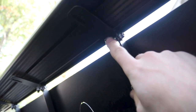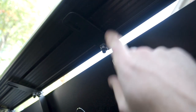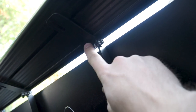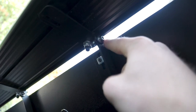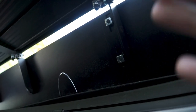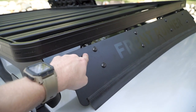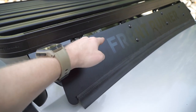This corner cap is held on by one bolt, so I just popped that right off. The underside of your mounts looks like this — a 13 millimeter bolt in the slot. I left them loose until I positioned it, then tightened those down. This smaller wrench that came with your roof rack adjusts the angle of it, and once you have that set you can lock it down. Then I came back and tightened down the front ones.